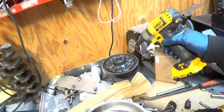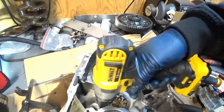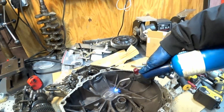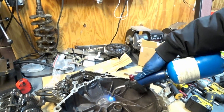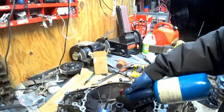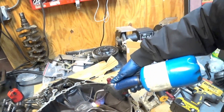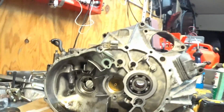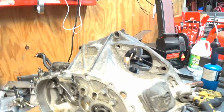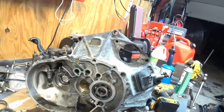The final drive is already out - the whole diff. I'm gonna take this out; I think these are 11s. The only way I found to get this bearing out is to heat it up - the metal will expand and then just tap it out a little bit. So this is how I'm getting it out. I just heated it up from the back, tapped on it a little bit, and it just fell right out.